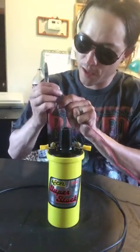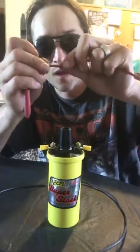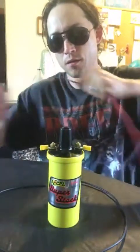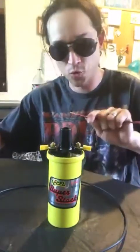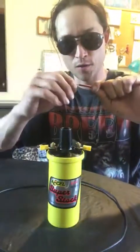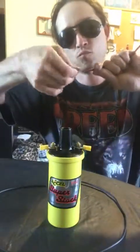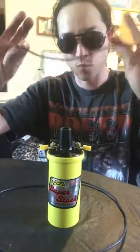And then once you get so far in, see, right there, it just splits. I don't know how well the camera's going to pick that up. And you reach over and, ta-da, perfectly stripped wire. Who needs expensive tools, right? Okay, that one's done. Because wires have a tendency to fray apart once you get them stripped like that, rotate them one way or the other and kind of twist them. Now, we're going to set that one aside.